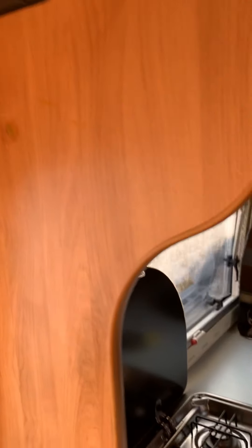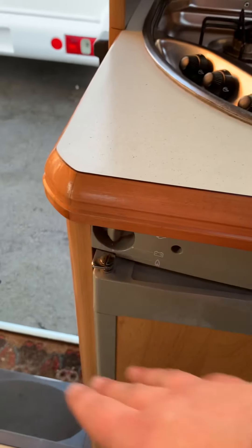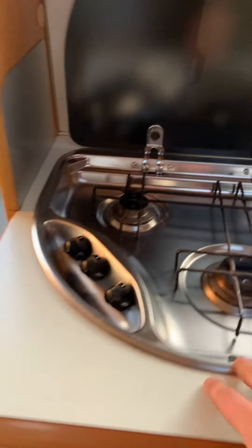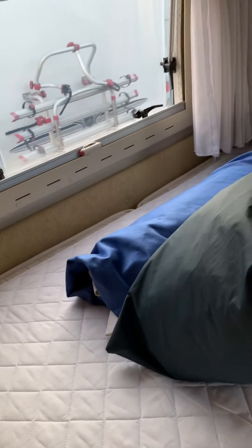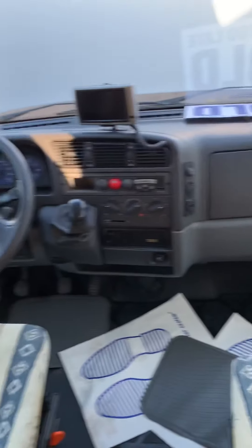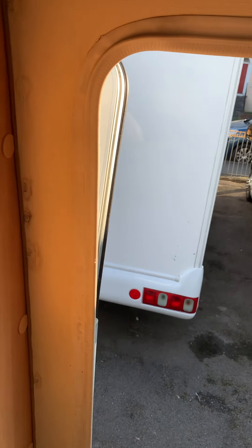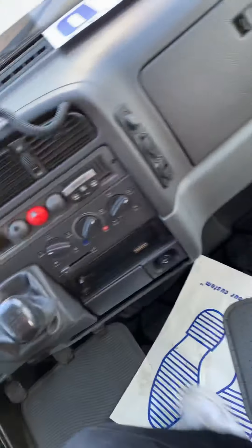So the main things: make sure there's no air in the system, make sure you know where your fridge is and that your gas is all the way on, and then it'd be good to go. All the lights have got their own switches so you can work those out for yourself. The hab check's all done — all went through nice and easy. Obviously when you're driving, you want to turn your gas off before you do. The reversing camera comes on as soon as you start her up.